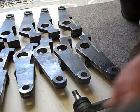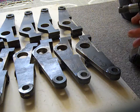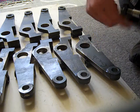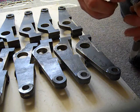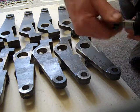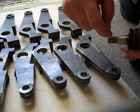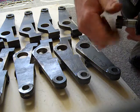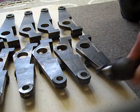I just wanted you to see what was going on and why. The black mark is right where the taper goes back the other direction — it starts tapering back into the ball. So that's where you want it to sit. That way, when the nut goes on and it snugs up, you see the full part of the hole with the taper in there. That way it'll allow the cotter pin to go in, but it also — if it's up high enough — allows the looped end of the cotter pin to fit in here without being smashed. And that's what we're going for.